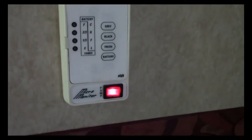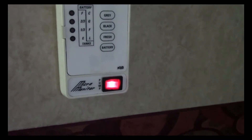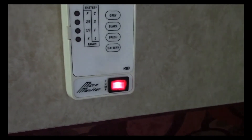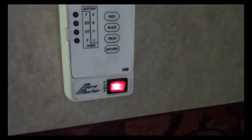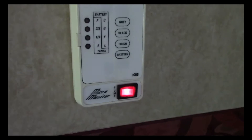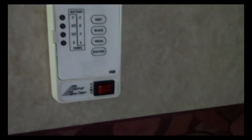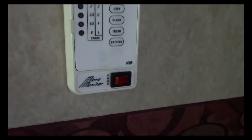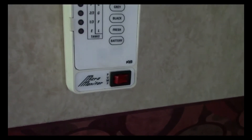Here I'm demonstrating the water pump switch — when it's turned on it has a little indicator light. You can save some amps from your batteries if you keep this switch off, so you don't have that little drain on your batteries from that light. But there's something even more important in play.